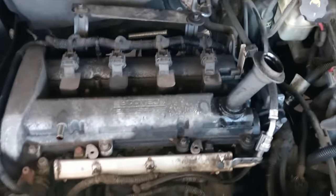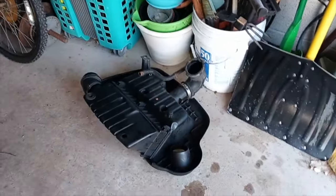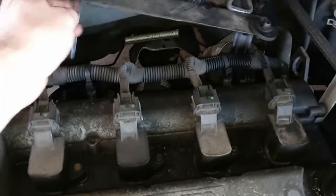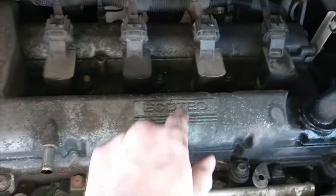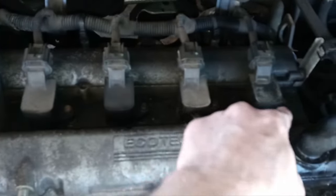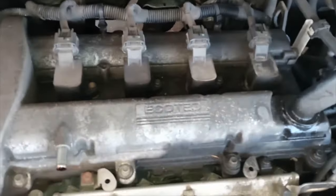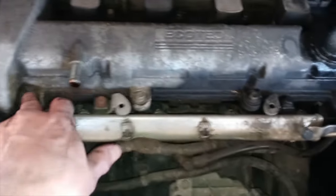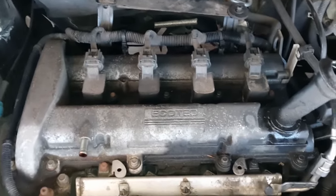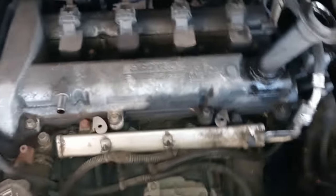All right guys, part two of this video — we've gone ahead and taken off the air filter air cleaner box, nothing too complicated. Now we're gonna get busy on the valve cover gasket. This is a support piece in the back for the air cleaner assembly, just one bolt along the back — I'll probably take it out to make it easier. We've got four spark plugs here in the middle. The gasket set also has grommets and the little gasket for each spark plug. We did replace these spark plugs at about 120,000 miles; the car's got 160K on it now. I counted about 14 grommets in the kit.